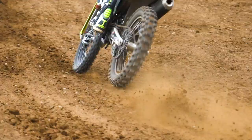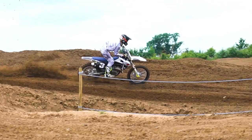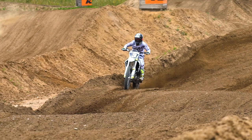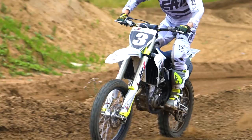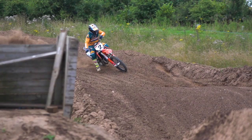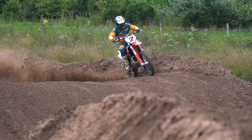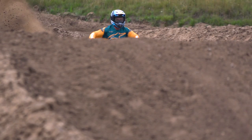Coming out of the turns, it's like catching a straight line instead of just wobbling. I felt like I could just stand up and lean instead of feeling like I'm risking everything. I've got the old shock on my KTM 125, and today I rode with the new shock and they were a big improvement. What we were playing about with today was fully closing it off, and it made all of the stroke quite hard, firm, and planted. Then going all the way open, the stroke felt softer and it was moving more, so it allowed me to transfer my weight into a different position. The two variables you could really feel.